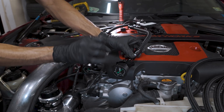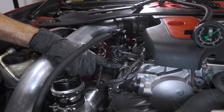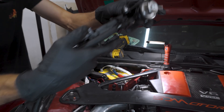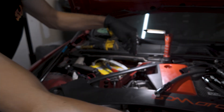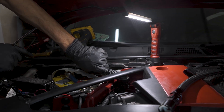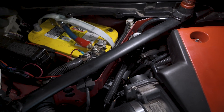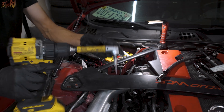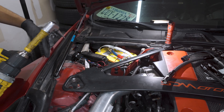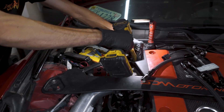Next up, lube up the O-ring with a little bit of oil — we don't want to tear it. It's going to mount right here into the OEM hard line. Once this is bolted down, get this into position, place the mounting plate on the back flat up against the sheet metal and mark the holes with a Sharpie. Get the regulator flush with the sheet metal. You are going to have to drill two holes using a drill, a 90-degree adapter, and a unibit. You'll want to remove the strut brace and the upper intake manifold to make enough space to get in there with this tool.